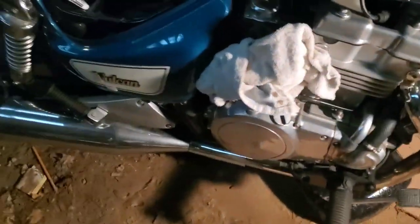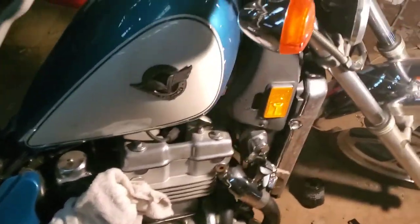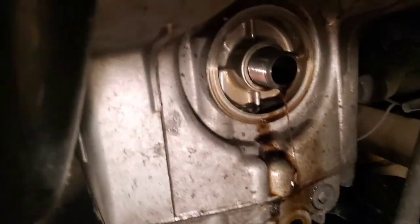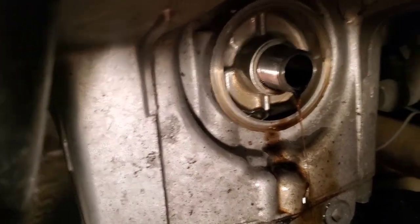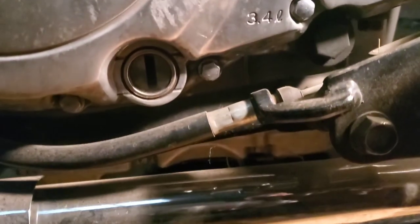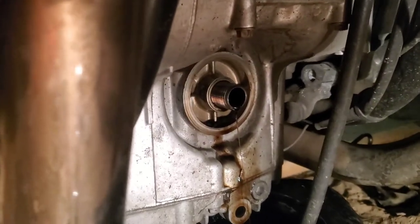Here's what we got figured out about it: carbs need to be rebuilt. I pulled the oil — I got some oil and a new oil filter. That's the old one right there. The oil is actually draining out, as you can see it's just about down to a trickle. That oil was actually disgusting. There's even a little side gauge right here that's supposed to tell you how much oil you have in it, and it wasn't even registering on there. So I shouldn't even have been running it, but it's better to know if it will run or not.